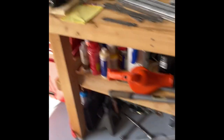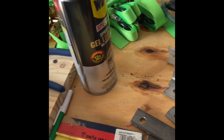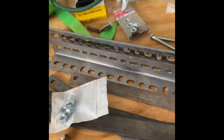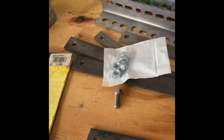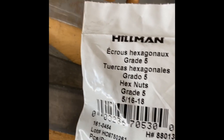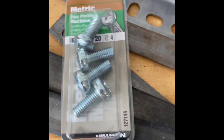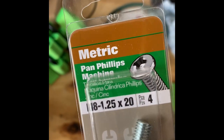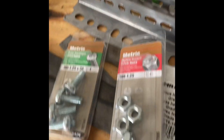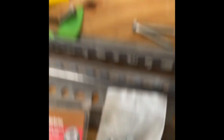I'm going to get all this stuff bolted together. These are the bolts and the nuts — there were six of them. They're 5/16-inch by 3/4. And there's the nuts for it, 5/16. For the screws that go into the roll bar, that's what you're going to need — metric 8 by 1.25 by 20. And just regular washers for the 5/16.